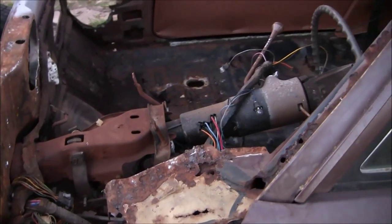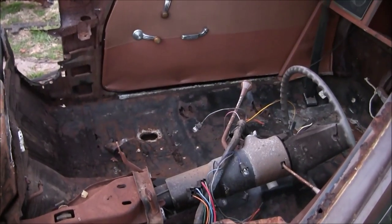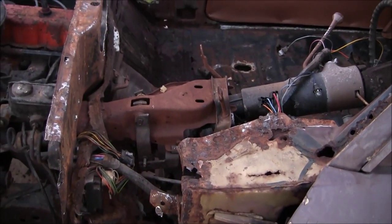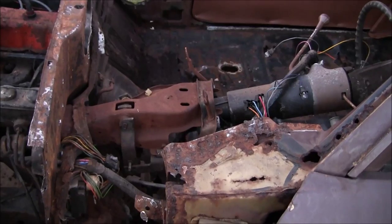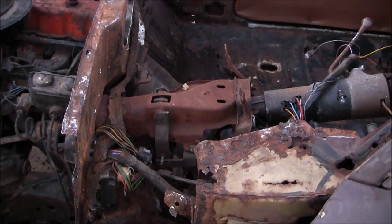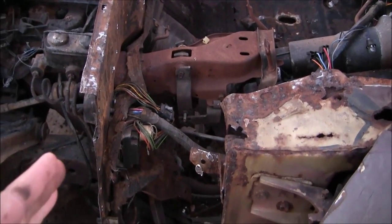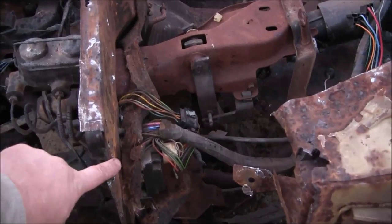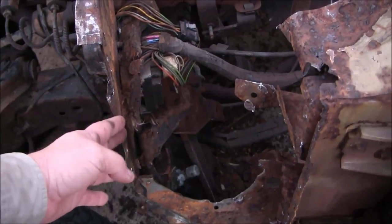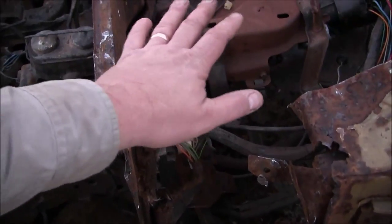I spent quite a bit of time on it today and a little yesterday. Most of yesterday was getting the interior out and the dash out. I'm going to start budgeting for a new upper vent cowl assembly and the two outer shells for both passenger and driver sides. They're probably going to go back in in reverse order. The proper way - the way the flanges were layered within the firewall - was the firewall first, then the inner flange of the outer vent cowl, and then on top of the outer vent cowl was the actual upper assembly.